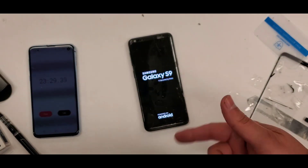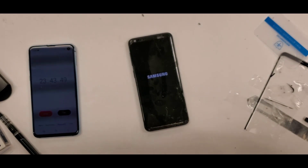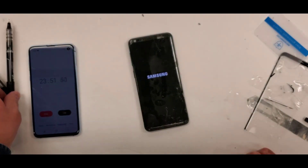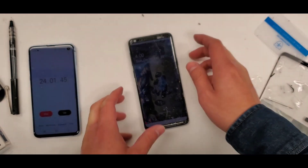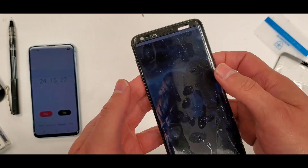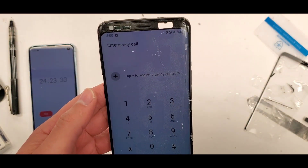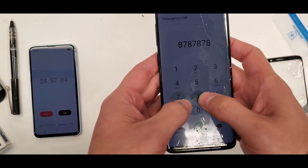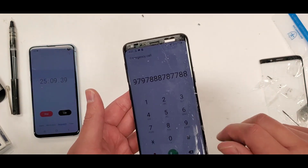We should be in the clear — let's wait till it boots all the way up. For a lot of people out there, this whole thing is worth the course by itself, because I know a lot of people are stuck on this thinking the freezer doesn't work with the S9 or S9 Plus. There you go — no display damage whatsoever. This is the Galaxy S9. Once it gets re-glued, everything will touch perfectly. Now let's put this in the cleaning mold and get this last piece off with the wire.